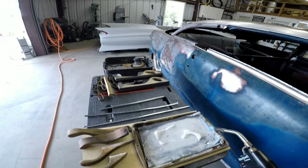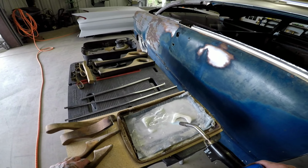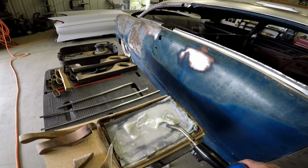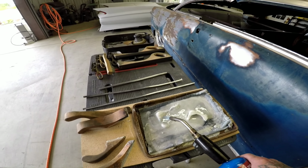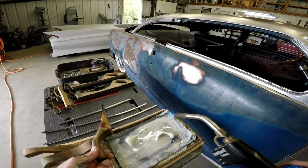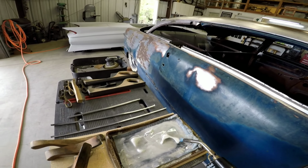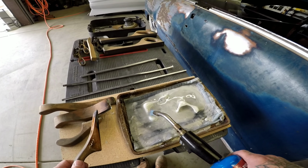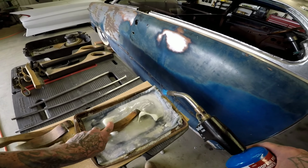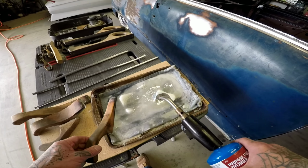So now it's called paddle lube. It's basically beeswax and whatever. They sell these products at Eastwood or online. I like to melt mine on a piece of jean, because you don't want a lot of lube on your paddle. I haven't even sanded these paddles in a long time, and they still work great because I don't burn them. But what I like to do is heat up just enough that there's a puddle there. See how it's soft? And then that's it. You don't want a whole lot of lube on the paddle.